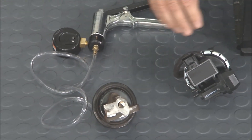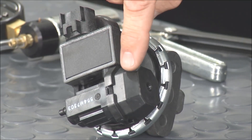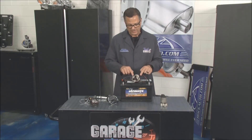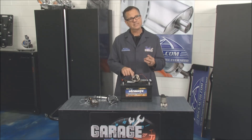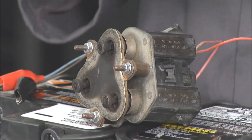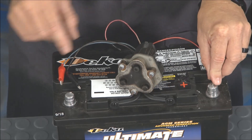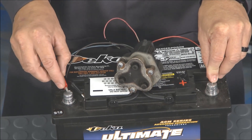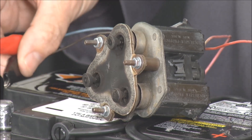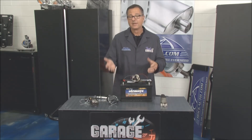Ford liked to incorporate everything into one — it's a vacuum-actuated valve but it has its actual pressure valve and solenoid to let the vacuum happen. From there, we went digital — the digital EGR. That one's right here and there are three solenoids on it. Think about it: 33%, 66%, 99%. It can open one at a time and let a little or a lot of EGR go into the car. I can demonstrate that — I click it and you see the solenoids activate. The computer is grounding them, opening those passages, and bam — exhaust gas into the intake, reducing NOx.